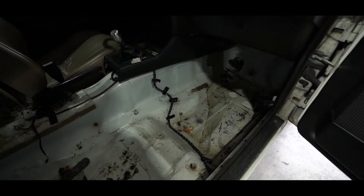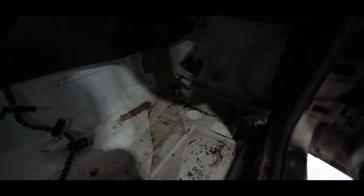The inside is where we're gonna get into some issues. We have some spots on the floor that need to be fixed, and there is some daylight coming through. Unfortunately, with these older BMWs, they have leaking sunroofs — the water comes in, leaks into the floor, gets trapped in the carpet, and it just rots away. It's a super common issue.